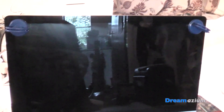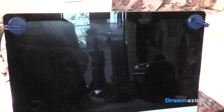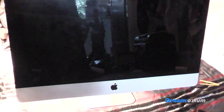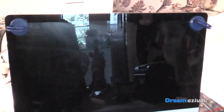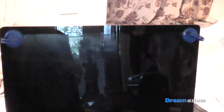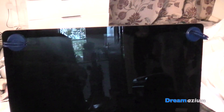At this point I used the microfiber cloth to clean the screen and the inside of the glass before replacing it. I've cleaned the screen and the inside of the glass and now I've put it back onto the iMac. You slide it, put it into the bottom, make sure it goes in correctly, and then gently put it into place and the magnets will grip it and pull it in. You might need to make sure it's aligned correctly where the camera is.